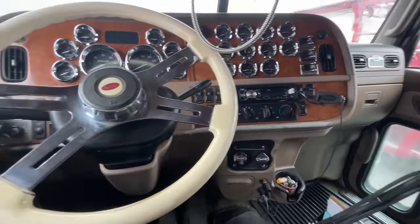When you're jumping full gears with the jakes on, it usually goes from 1700 and I bring it down to about 1300 or 1400, and then you can drop a full gear. If you're jaking half gears, like splitting every gear going down, you can usually get 1700 down to 1500, split the gear, and then it'll go up to 1700 again and down.